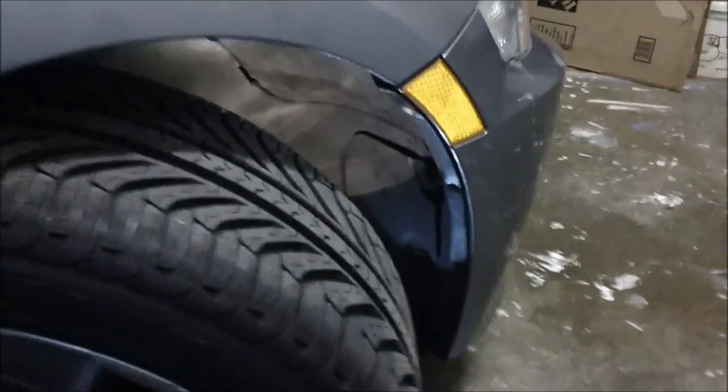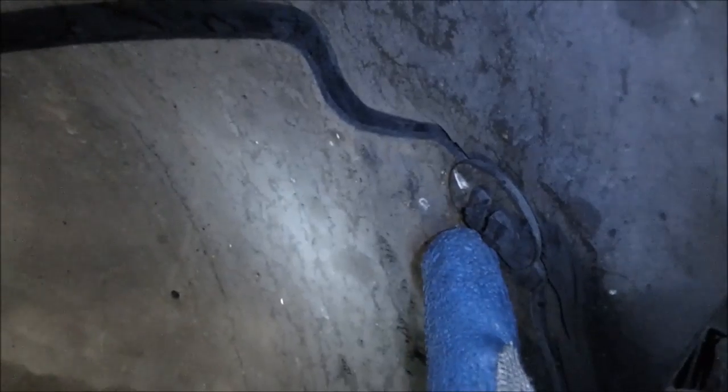Okay, I'm going into the wheel well. The first step here is to remove this cover — there are some tabs here and up here. I've used a putty knife. Find the groove and rotate these tabs 180 degrees — one right there, one up top. The cover will come right out.